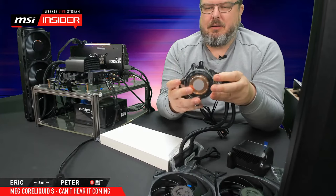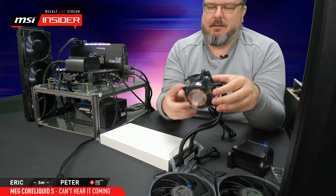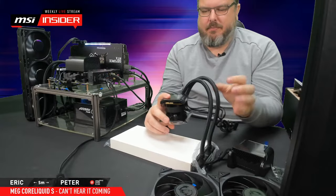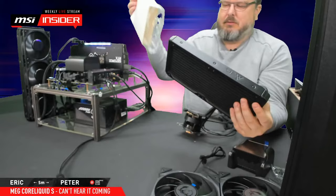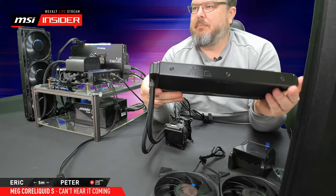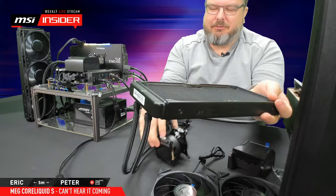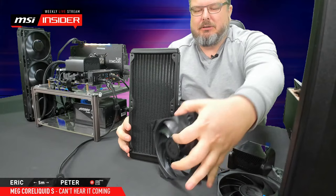This is the radiator — it looks different because I see MEG on the side. It is a bit different because it needs to be bigger to fit the 140mm fans. There's a question from No Woon on YouTube: how does engineering know how much thermal paste is enough? The thermal paste is only needed to fill in the gaps between the copper plate and the CPU — you need only a really thin layer.